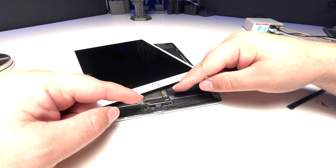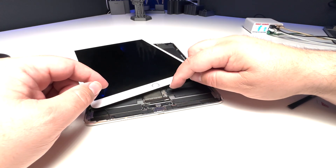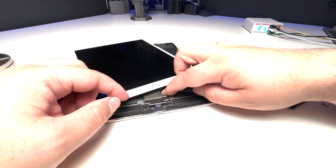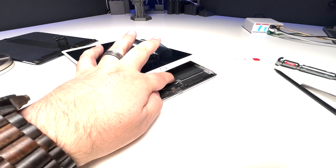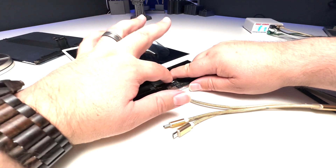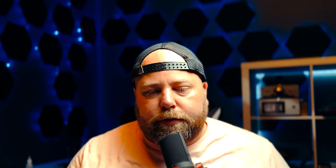At least I've been able to show how to replace the charge port and isolate another issue that was caused and fix it. I'm going to run a couple more tests just to make sure it's not just an issue with contact on these pins. Testing with another display just to make sure — no image as well, so it's not an issue with the display, which is good. The iPad still needs a bit more work, but I was able to show you how to replace the charge port. After doing some further testing I'm pretty sure I know what more this iPad needs, so it's quite possible I'll show you the solution in a future video. If you have any questions leave them in the comments below. Thanks for watching and we'll see you tomorrow for Tips and Tricks Thursday.